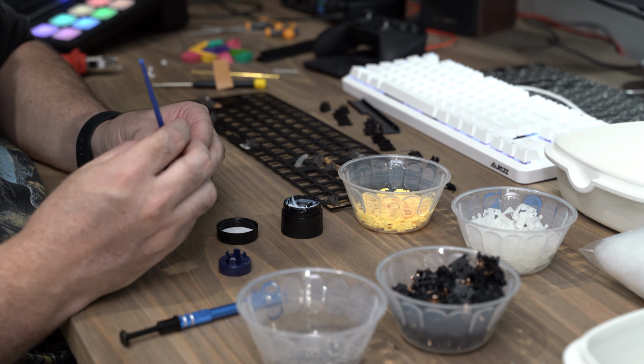I would suggest watching a video by Teha on how to lube switches. I watched this video and I still somehow managed to overlube. Less is absolutely more when it comes to lubing switches. And believe it or not, you may think that you're putting nothing on your switches. However, you are definitely putting lube on those switches. So be very, very sparing with the lube.